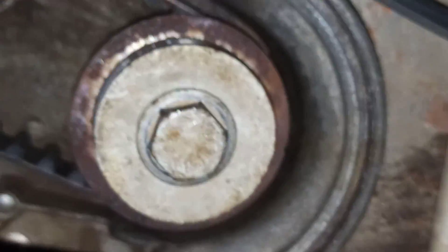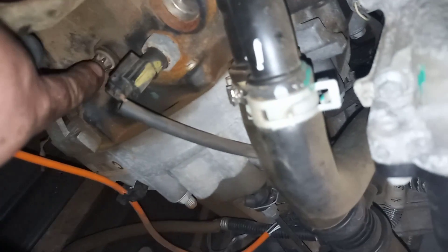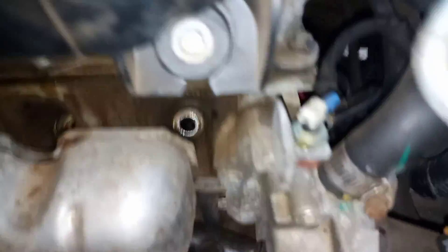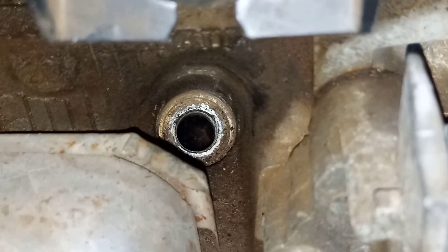The sheet metal marking — as you can see there's nothing there, so we have to set this the old-fashioned way. The proper way is to insert a timing tool into this little bolt hole here, but I wasn't able to get that done. So the old-fashioned way: engine supported, spark plugs removed for low compression, and I just used a beam to get cylinder four on TDC.